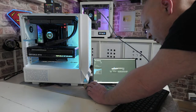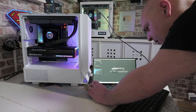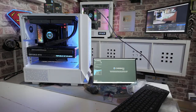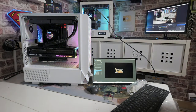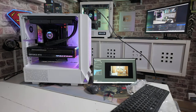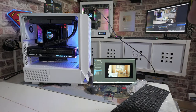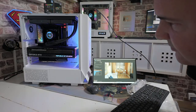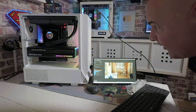And I think we'll do a 5 minute loop possibly. And we'll do the advanced benchmark. So let's just hit it with a multi-core load. We'll just do a single loop and see. Those fans are ramping up now. And temperature wise, we're getting up to about 79 or so peak there. 74 we're running at, 75, 74. That's not bad. Normally those hit like 90 pretty quick. 75, 74 seems to be in and around that. Then drops down to 29, 30. That's great. I like that cooler.